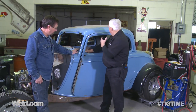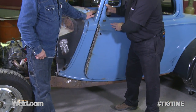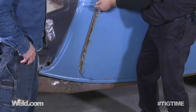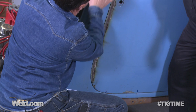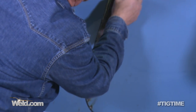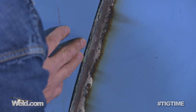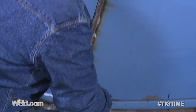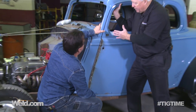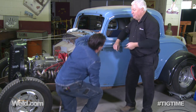Well Tommy, we got the door back on. It looks like you've done a rough grind, a rough polish, and we put the door in position to check our alignment. The alignment is good on the door. We'll have to come back in a few areas and put some more weld on — just a few areas here and a few areas down here — then smooth it up and we should have our gap. Yeah, it looks like it's getting there. In fact, right here I'm going to do a little repair right now while we've got it. I'll do the repair, push it back there, and you take a look and see if I've got enough.